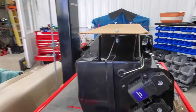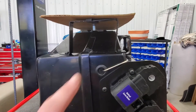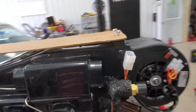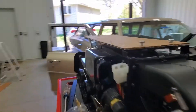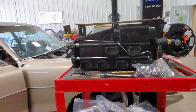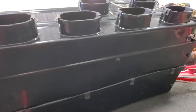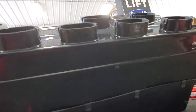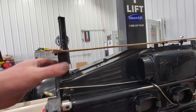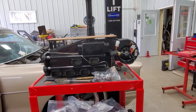With the aid of our cardboard-aided design, we need a new bracket — and yes, this bend is on purpose because there's going to be a lot of weight. That's the original bracket. Now we know our bolt spacing and we have something that's a lot flatter, because our firewall will be flat. Even though that's all they intended according to their instructions, I think before we're done we're also going to put a bracket from the front somewhere up into the structure, because this is a bit of weight to just hang off a couple bits of sheet metal.